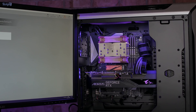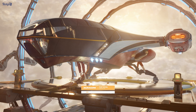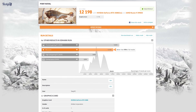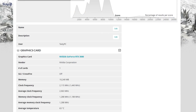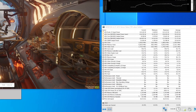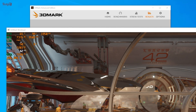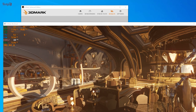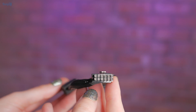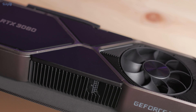Given that this is Aorus's highest-clocked 3080, I thought it'd be fun to do some overclocking using the 3DMark Port Royal benchmark. My best score with a Founders Edition 3080 was 12,198, achieved with a +160 core clock offset averaging 2063 MHz during the benchmark and +800 on the memory. With modern Nvidia cards, the GPU boosts itself until it hits a limiting factor — temperature, power, or voltage. With the Founders Edition it was limited by power, and using two 8-pin connectors means a maximum of 375 watts to stay within spec, so Nvidia limited it to 370 watts.